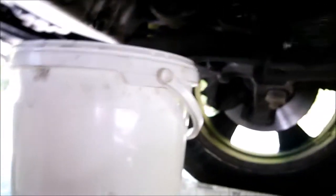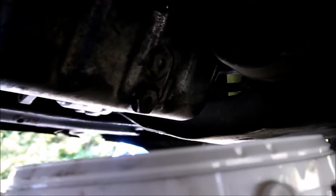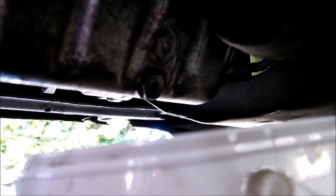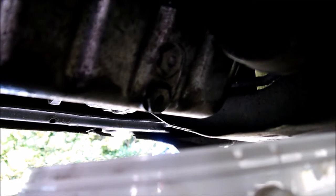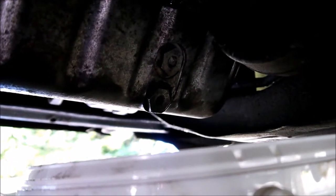So here it is. I've got a nice big bucket underneath to catch the waste oil. I'm going to find the appropriate spanner to get that off. Some sump plugs have Allen key drive, some have Torx drive, some take sockets — it just depends on each model. Every single model will be different, so you'll have to look under your car and find out exactly which one suits you. On this 2001 Citroën Synergy, which actually has an engine from 1999, this takes a 21mm socket.